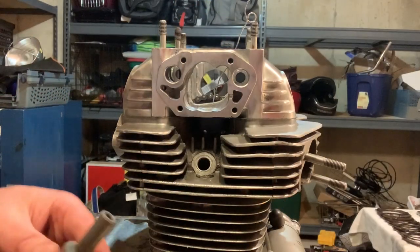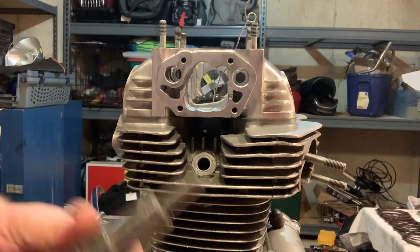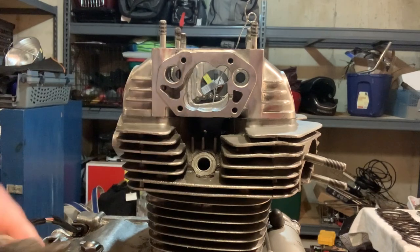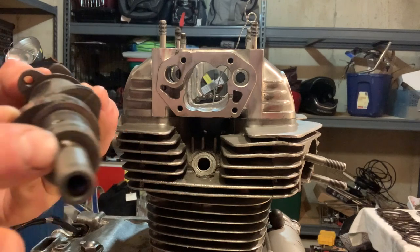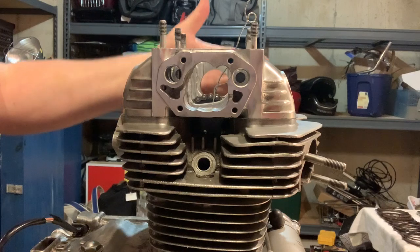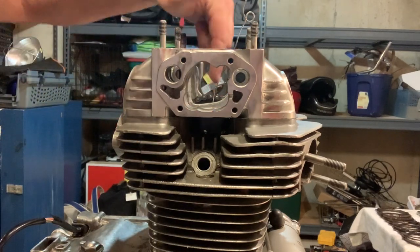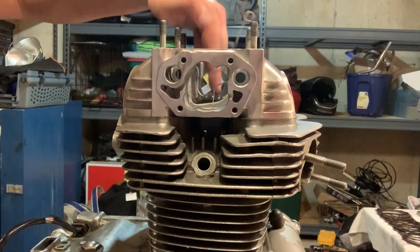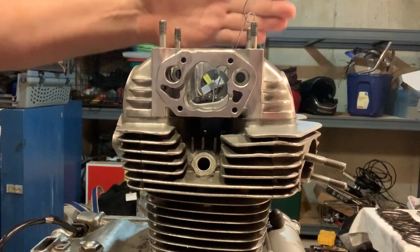Next up, grab your camshaft by the round end, not the spindly end. Grab that end of it, and you're going to go in through the right side of the engine. Now your end goal is to get this camshaft with this pin pointed straight up. So the engine is in LT, and then we also want our sprocket, which is hanging out down here. There's an L mark and a flat line on the actual black sprocket. That needs to be flat with the head here.